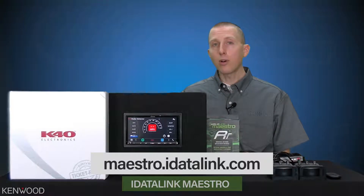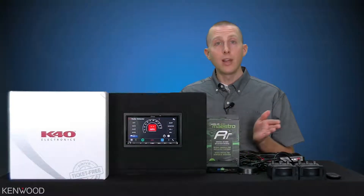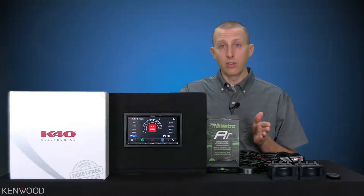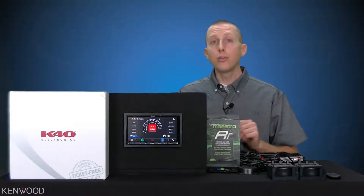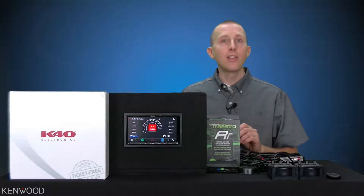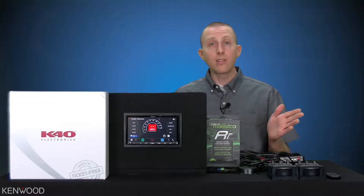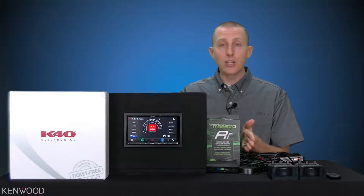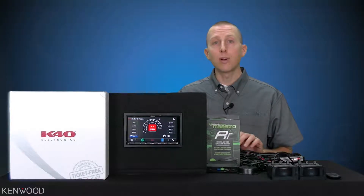What's great about this is if you are flashing it for a specific vehicle, you can simply flash it as you always would to replace the radio, and it will then automatically work with the new K40 system. Keep in mind that if you had a prior installed system of a Kenwood, you will need to reflash the Maestro RR as iDatalink has added in all new firmwares for individual vehicles. Alternatively, you can flash this universally, meaning you do not need a vehicle that is iDatalink Maestro RR compatible. You could in theory put this in a 67 Chevy — you can simply flash it universally and that will allow the Maestro RR to help the communication path between the K40 and the Kenwood directly, completely isolated from the vehicle itself.